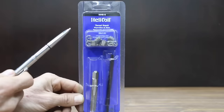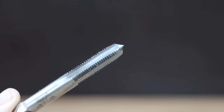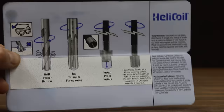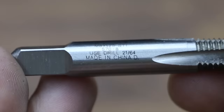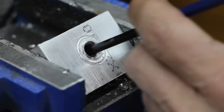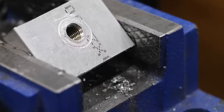At a price of $25, you can buy the actual name brand — the Helicoil brand thread repair kit. Stanley engineered fastening; tools made in USA and China. The Helicoil kit includes a tap, a repair insert tool, and 10 repair inserts. You'll also need a twist drill and a punch. The Helicoil brand comes with a very nice set of instructions. Step 1: drill out the damaged threads — the Helicoil kit does not include a drill bit, but stamped right on the tap it says use a 21/64 drill. Step 2: tap the hole. Step 3: install the thread insert so the top is a quarter to half a turn below the top surface, then use the punch to break the tang at the notch at the bottom of the coil. The punch must have a square end. The repair is finished and the bolt fits nicely.